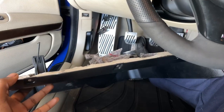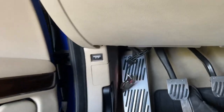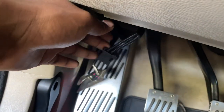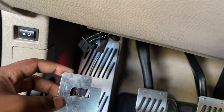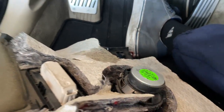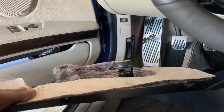Starting with the master cylinder — the first thing you want to do is remove the under-trim panel below your steering wheel, kind of around the pedals. There are three T20 torx screws in these little slots. You have to kind of finagle it out of the spot. Also unplug the various connectors: there's one over here, a plug over here, a little satellite or SOS system connector, a connection for the light, and the SOS speaker. Once it's removed, you can fully pull this out and put it aside.